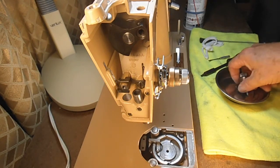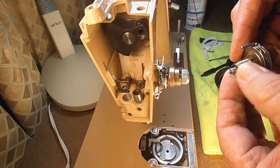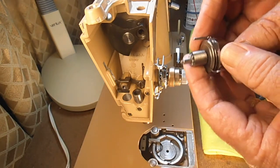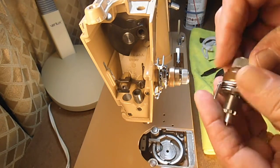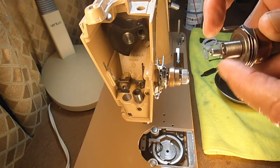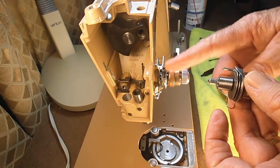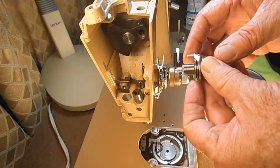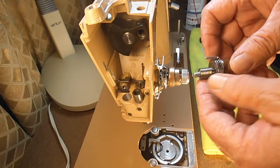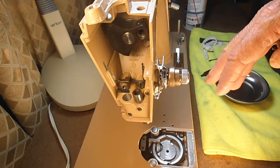A lot of people feel that doesn't count up here because you can just give it a little spray and get it off. But if you saw the whole tension unit when I removed the whole assembly before — in here is the thread take-up spring, and for it to work properly it has to coil a little bit back and forth as it works, and that coil of the spring has to turn. Even though it's inside there, when you blow that compressed air, that tunnel or hole where this mounts into can get all impacted with lint and dust, and I've had them to the point where the spring is frozen and it can't function properly, and people have lost their tension. So I don't really recommend compressed air, the bobbin area, or any part of it.